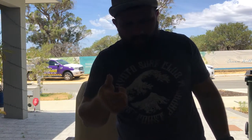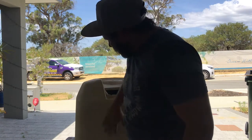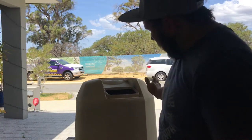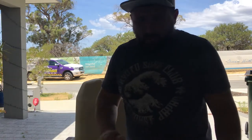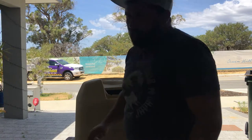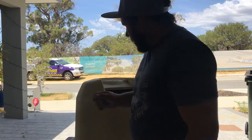Once it's smooth with 180, I'll put a light coat of 400 grit over it. When that's done, I'll get the wax and grease remover and wipe it pretty much all over it, just so there are no dust particles or any grime. Once that's done, even though it is a bit windy at the moment, I will do a test coat with the top coat.